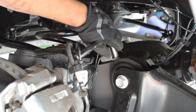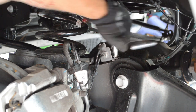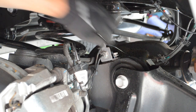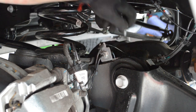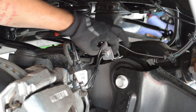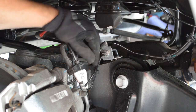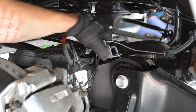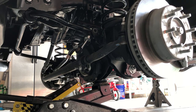Disconnecting the bracket from the axle will yield some play in the lines so they don't get snagged on anything. Also watch for the vent line if you're coming down quite a ways — it's just a simple line that gets stuck on there, and if you pull it off you can reconnect it. Take these loose on both sides so you don't start bending the brake lines. Then we'll come down just a touch on each side to lower and remove the springs.